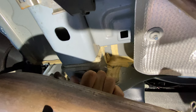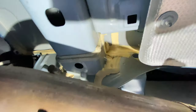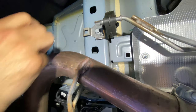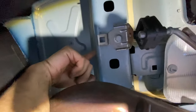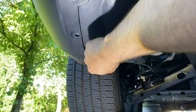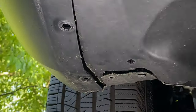This is the tricky one because you can't even see it — it's near the exhaust. There's like a piece of tape — there it goes. So here are the three holes: you've got the first one by the exhaust hanger, one round hole and two square elongated holes. These are going to be the three mounting points where we snake the hardware through. There's a hole on the side and we're going to fish the hardware through that hole into all three locations, then line it up and get it secured. Also on the driver's side, there's a drain hose with little teeth — push it through and make sure when you reinstall the panel, you first insert that hose.